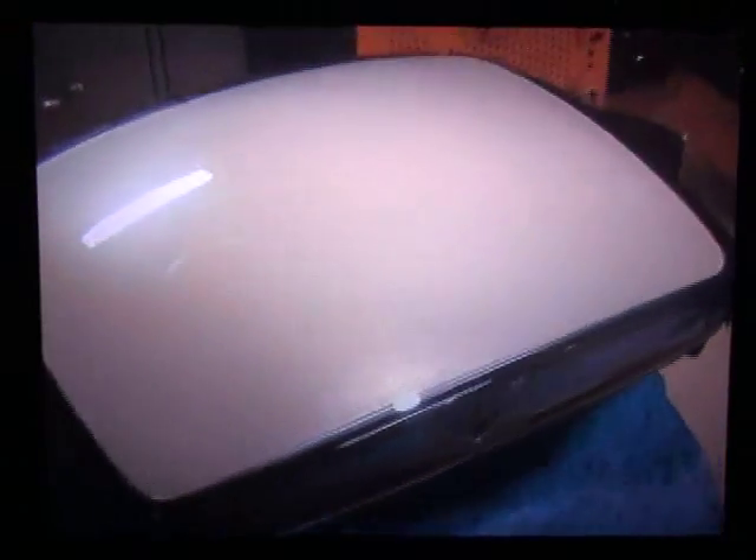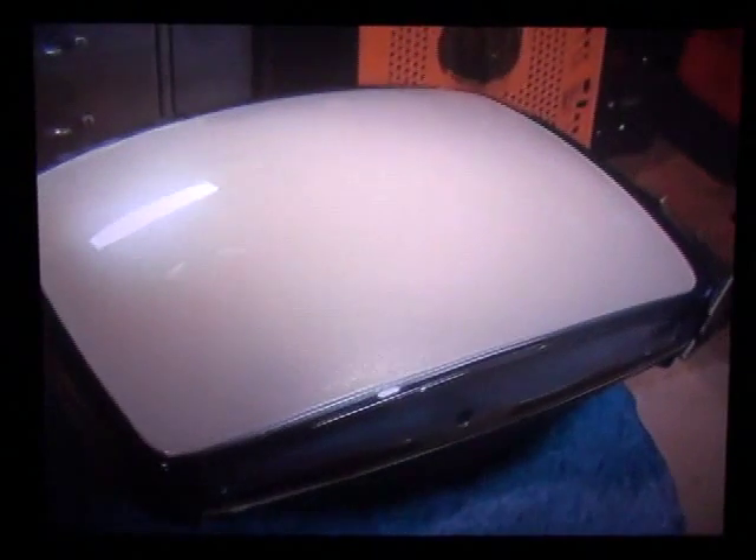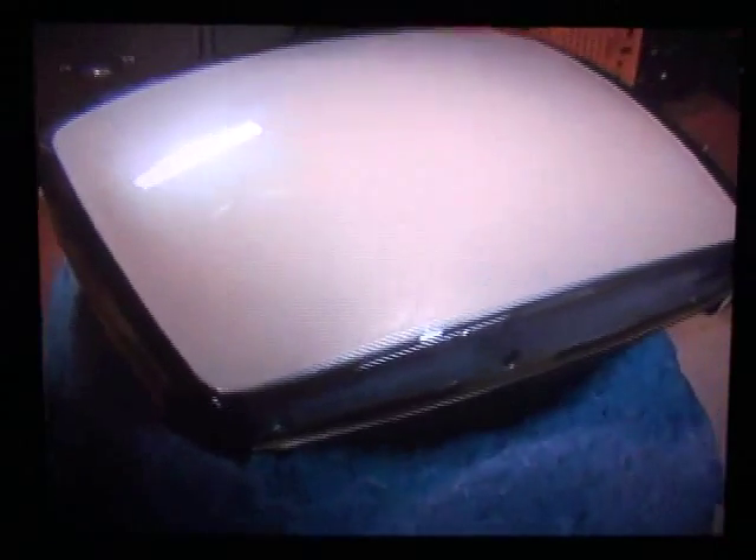Clean the CRT face with Windex and a towel, and then for a finished streak-free surface, use Windex with newspaper — you'll have a perfect clean glass surface. We're ready for glass mounting once we install the double-sided foam tape around the perimeter at various points. Then we'll set the lens on the CRT and make a complete seal with clear packaging tape all the way around. Once that's done, the CRT will be ready for reinstallation into the cabinet.